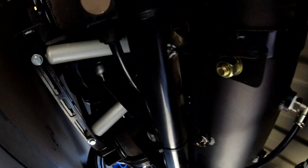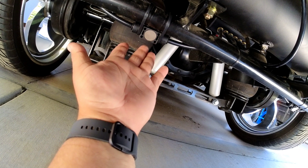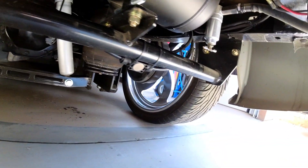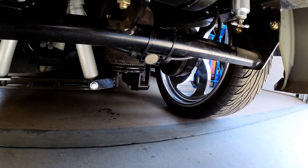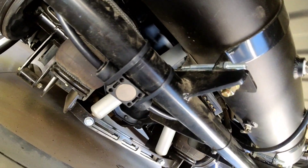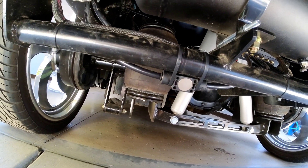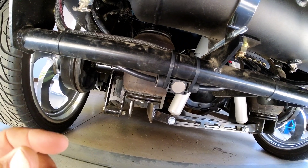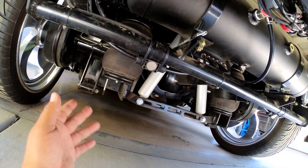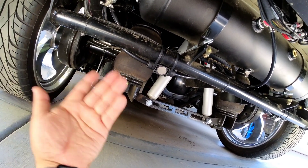We got the compressors running. I adjusted everything and I just spun them this way because I didn't want the head sticking down or out where it could get hit. I did the same thing on the other side, as you can see right there. I ended up adjusting them about 10 turns out. I adjusted them evenly, but I can always readjust them since they're in an easy place to reach. I'm probably going to end up getting some for the back also, but I'll put them on in reverse so it slows the back coming up — the back lifts up super fast.